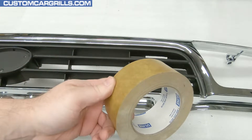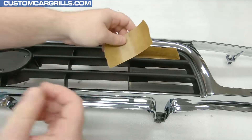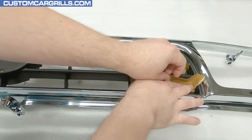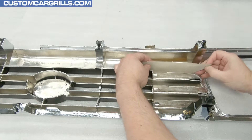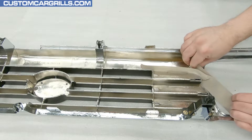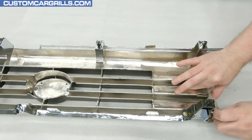On the front of the grille, there's some open slats that I will want to plug up for the next step. Some tape can easily get the job done. There are three openings on each side, and once they're blocked off, I'll flip the grille back around. With the same tape, I'm going to build up a temporary barrier for our repair material that's going to be used to bridge the gaps left from the cuts that will be made.